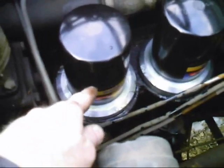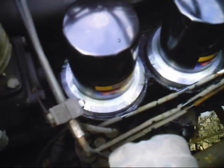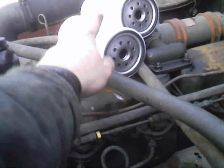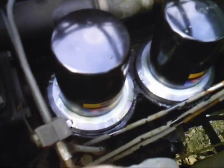The threads on these filter bases are 13 sixteenths by 16 thread. There are a lot of filters — these are the two types I use. I do use the 1794s sometimes, but not often. Everybody thinks they have to have a huge filter, but these smaller ones do the job. Worst case scenario, if you don't think they're going to do a good enough job, you have your oil pressure gauge — it will start to drop showing your filters are plugged.